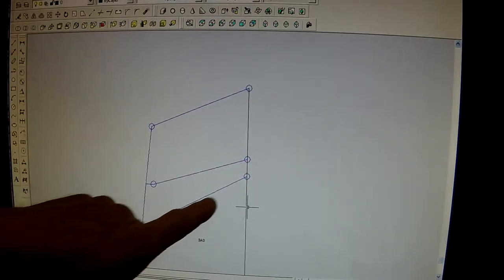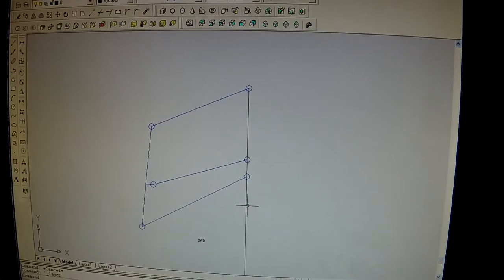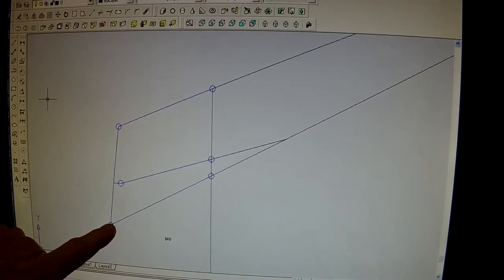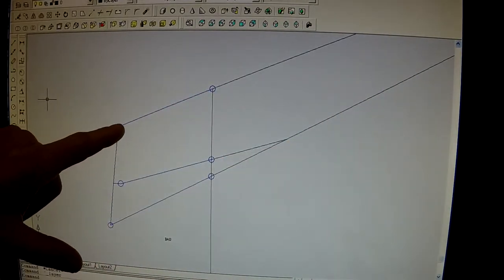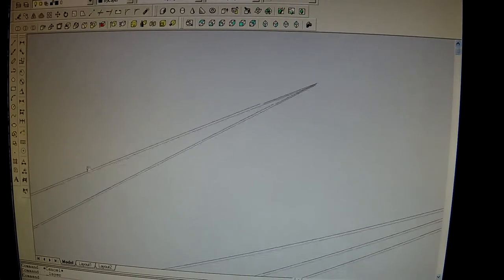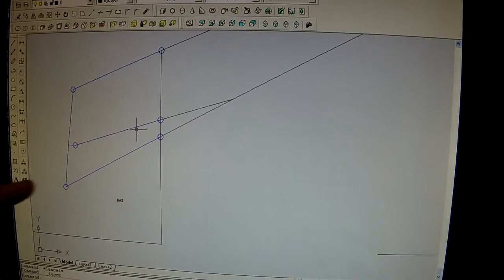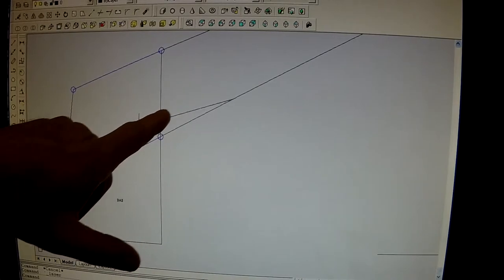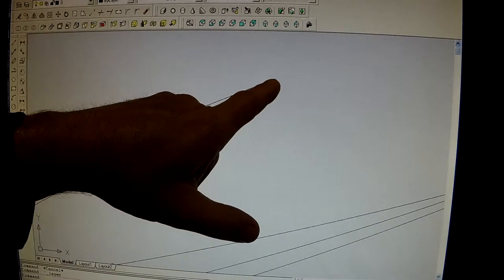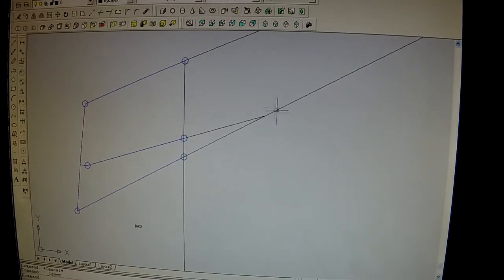As you can see, this line and this line are not parallel. This is where I originally mounted the rack, much lower. If I draw a line from this pivot to that pivot off into infinity, and then from this pivot to that pivot off into infinity, they meet way up here — that's the nexus of those two lines. What you want is your steering rack line to come all the way up and intersect at that same point — the virtual pivot. But as you can see, my steering line hits way down here. My steering geometry was completely off.